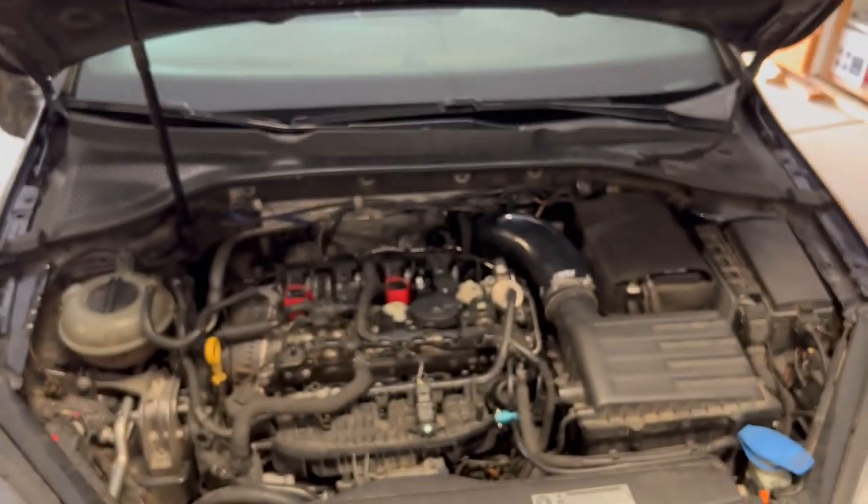I'm going to take it for a drive. I took it for a drive, did a couple of pulls, pulled over and checked for leaks — and there were no leaks, which is awesome. I'm glad I got that leak fixed. Now there won't be any oil going down the engine block onto my oil pan and transmission and dropping on the floor. I'm going to continue putting cardboard under my car for the next two or three days just to check for any residual oil that's still there and wanting to drip.